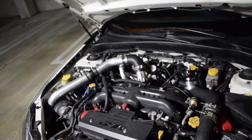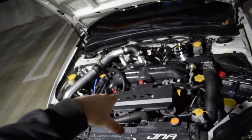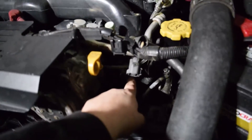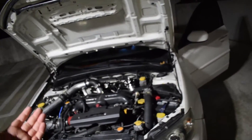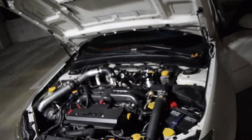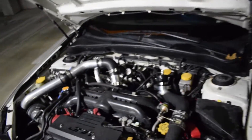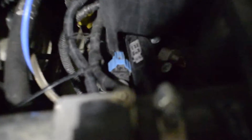Moving on from the heads, now we're up to the TGVs. Stock, these cars have a little butterfly valve that closes half of the intake runners off — almost like a choke in an old carburetor car. I deleted that for better flow and ported and polished it a little bit. Then working off the TGVs, I have IAG fuel rails. The stock fuel rails are pretty good for most horsepower applications, but since I want to go E85 in the future, I wanted the headroom for when I upgrade.